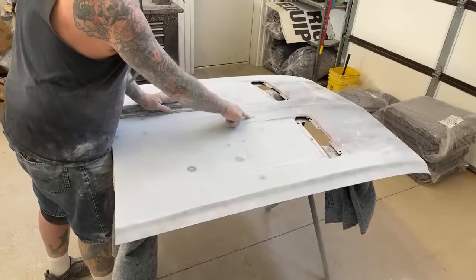I've got several hours of work ahead of me just to get this hood in shape. This is not a quickie fix by any means - this is a time-consuming type of job. Somebody might say: why didn't you just grind it down to bare metal? Because when you use grinders and high-speed air tools on a hood, it heats the metal up and it can warp it. It's best to hand sand everything on the hood. I only used the air tool to break the bondo - I did not use an air file. When you use air tools it creates heat, and it can actually make the problem worse.